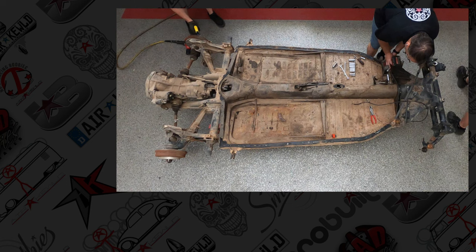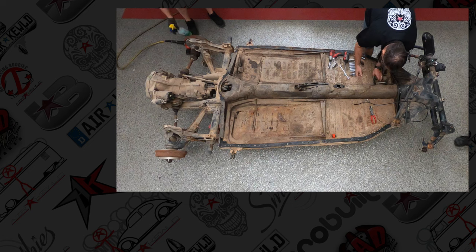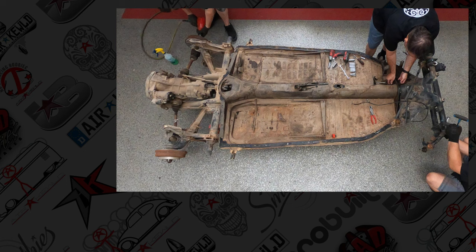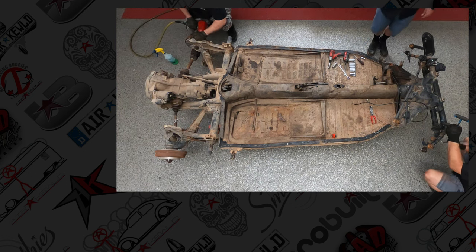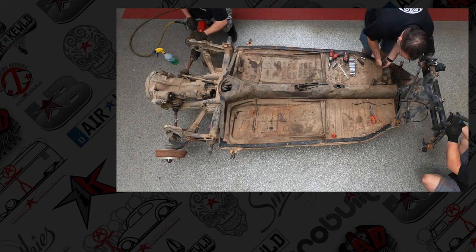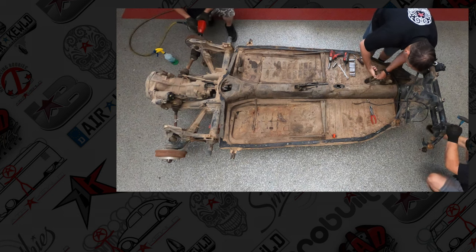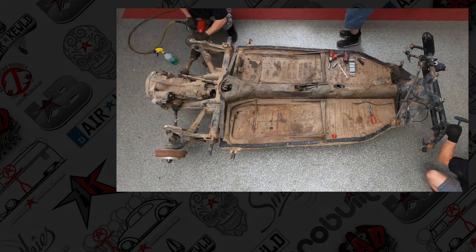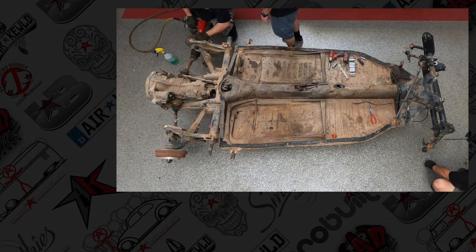So these specific axle nuts were on uber tight. Normally our half inch Snap-on impact will just rip them off. But these must have been put on with a pretty sizable, maybe a 3/4 impact, because we had to soak them. We had to let our air compressor get all the way up to 175, and then let it vibrate and hit it, but we got it.